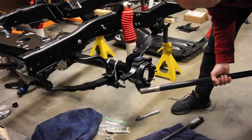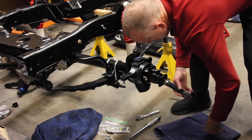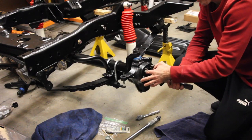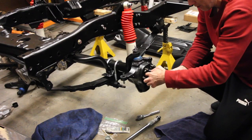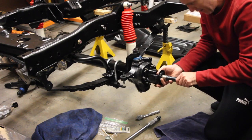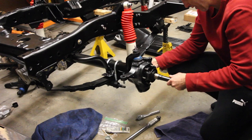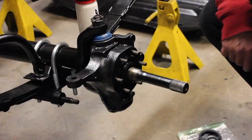Now we're going to put in the axle — just slide it in. I've seen a couple of people who replaced the universal joints on the axle with the spindle and didn't get them seated deep enough or flush enough, depending on the brand, to where they wind up coming in contact with the axle hole of the wheel hub. They've tried using an angle grinder to grind out pathways so the thing would fit through. You want to make sure that your universal joint is seated as flush as possible to the actual knuckle.